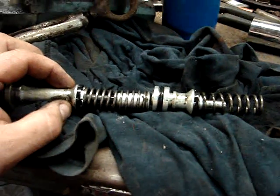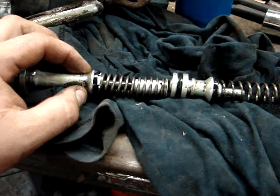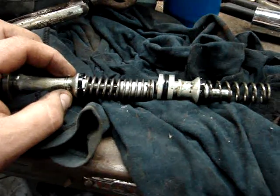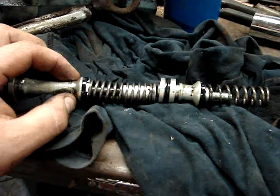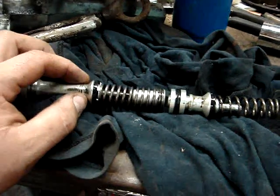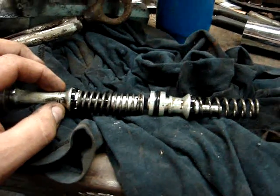Number one, I think the back brakes are self-adjusting. There's two cylinders in the brakes, and each cylinder is one way. I mean, there's one piston in each cylinder, and each cylinder works one of the shoes. And I don't believe there's any adjustments. I can't find anything online, and I really don't feel like pulling it all apart.